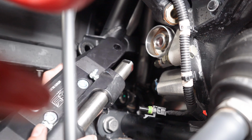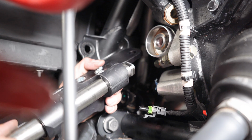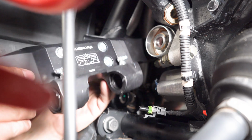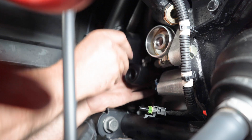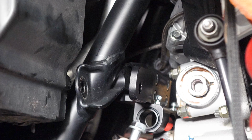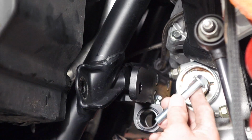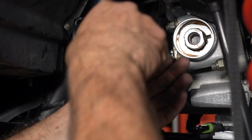All right, so now that we have our upper control arm pulled out of the way, we have plenty of working space. We're going to slip the drag link rod out and put the body right up in over the differential. Now with the stabilizer body resting up in the gusset's location, we're going to use the supplied chrome vertical bolts, install them from the top down. Now we're going to reinstall the drag link rod with the body floating loose.